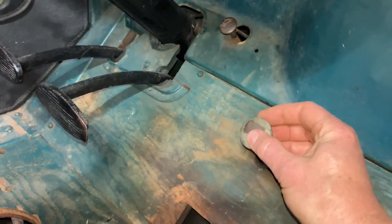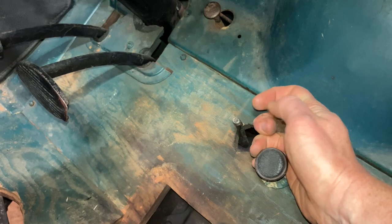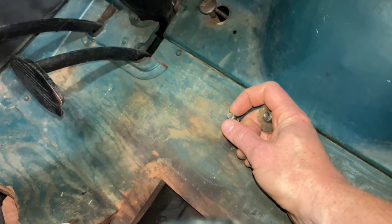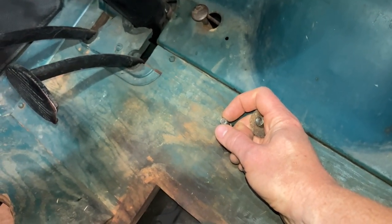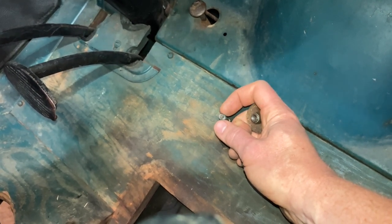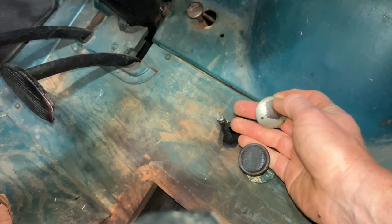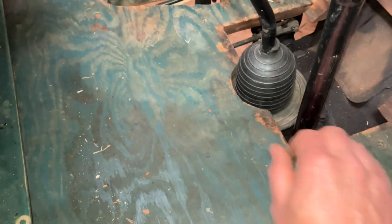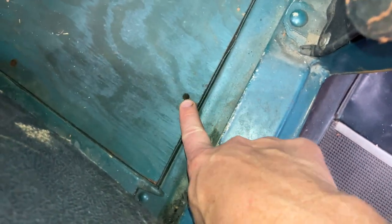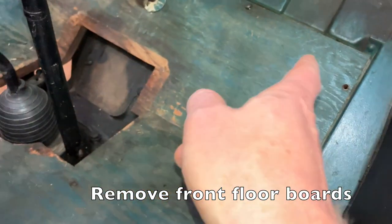Take off the accelerator pedal, which just unscrews. If you take it off and underneath there is a funny-looking lock washer that is knurled around the sides, keep that — it's a very rare item. It was only done in 1928, nobody makes them anymore, and they're hard to find. You can probably sell that for good money to somebody doing a fine-point restoration. Take the pedal off and the plate off. Once you've done that, go ahead and remove these boards — they may or may not be screwed down, but take this board up and take the screws out.